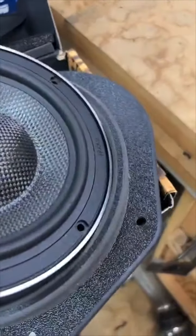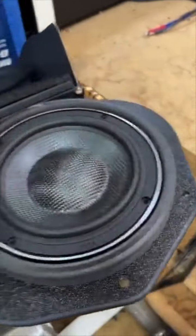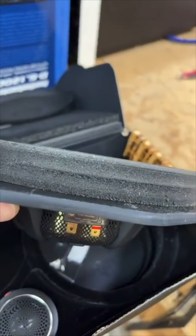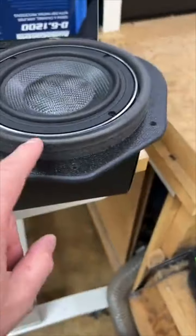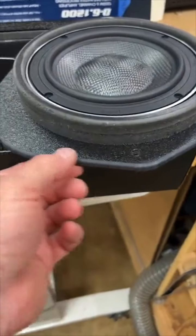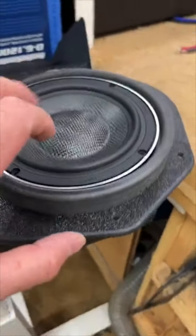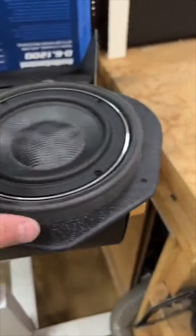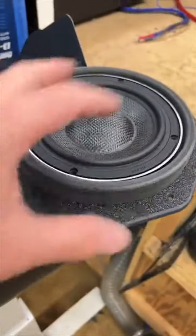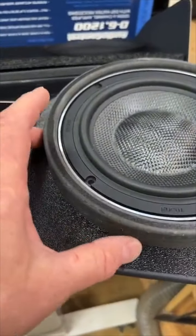This is going to sit inside of here. We'll use a bigger fast ring to make an 8-inch fast ring. So it'll go around the outside of this. The speaker kind of sits flush inside of it. Made out of three pieces. So we have two pieces of 1/2-inch Sintra and one piece of 1/4-inch ABS. Different materials, different rigidities, just a different process altogether, instead of just doing an acrylic piece. We just wanted to try something different on this one. The rears are just made out of 1/2-inch.